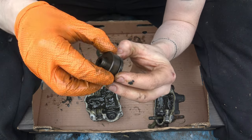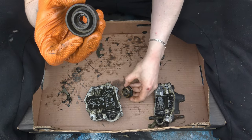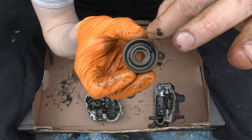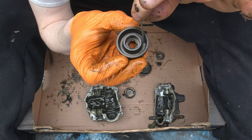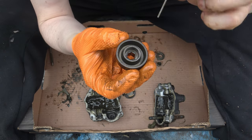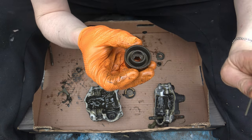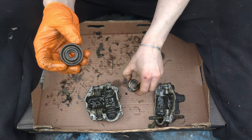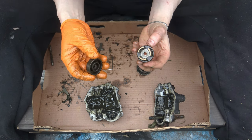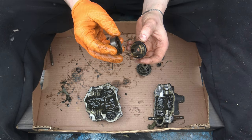Rather than removing the excess material off the friction area on the brass parts, what I'm going to do is remove it off the inside of the basket instead. This will allow these little brass parts to go further into the basket and meet the face where they need to meet. At the minute, when this has been pushed up against the basket, these little brass parts - because there's a little bit of material worn off both sides - are going too far in and hitting the inner face of the basket. You can't buy parts for these gearboxes, which is why I'm doing this modification rather than spending £400 on a new gearbox.